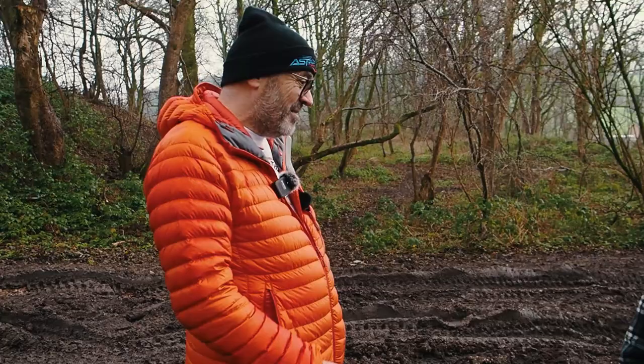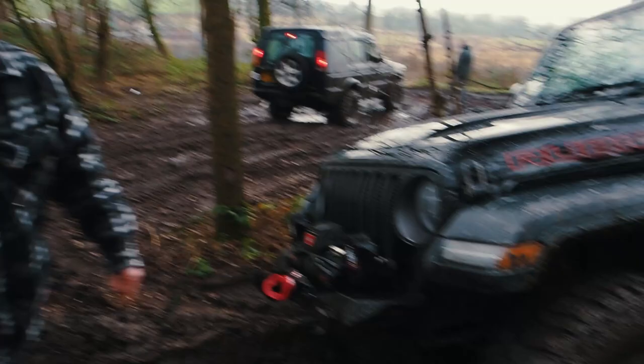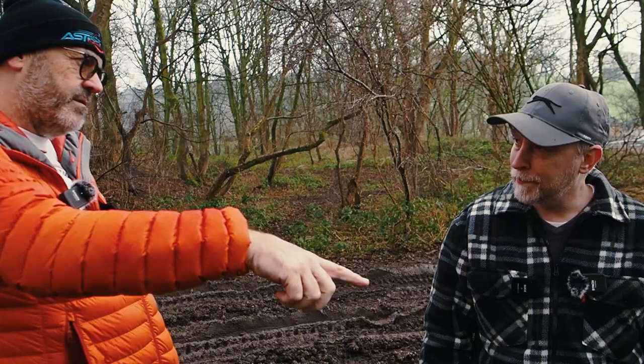And I assume with the Rubicon, it's got the automatic sway bar? It's electric. You press the button, it switches it on and off. So handy, because I used to have an XJ years ago, but that had the removable link. Yeah, and you get muddy, especially now, like down there, you see that mud underneath? You've got to get your hand underneath to pull that link out, or put it back in, it's the worst thing at the end. Yeah, no, just press the button and wait a few minutes for it to sort itself out, and it disconnects. So it's not instantaneous? No, there's a slight delay with the electric motor. On an angle like that, it wouldn't disconnect or connect. It has to be on a flat surface for it to line the motor up, I guess, or the bracket. Yeah, it's quite a lot of pressure on the torsion bar.